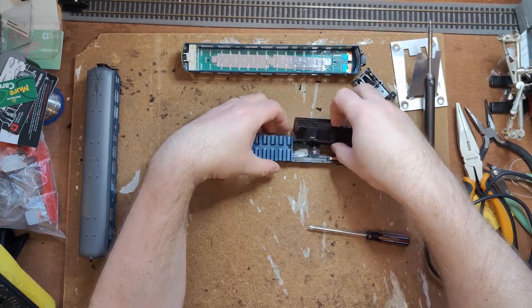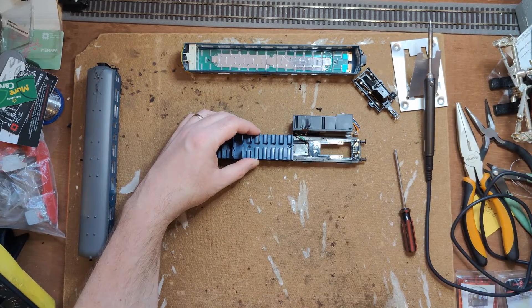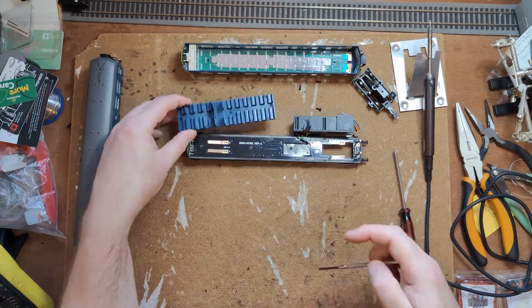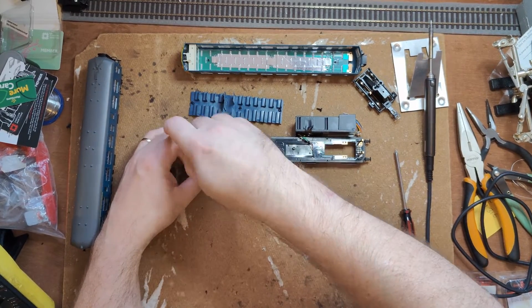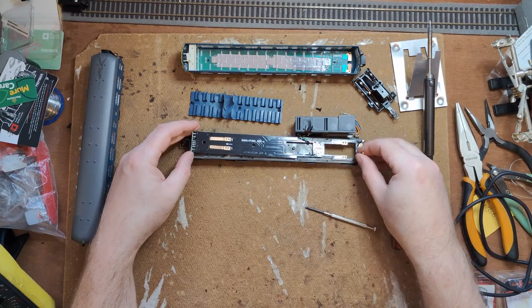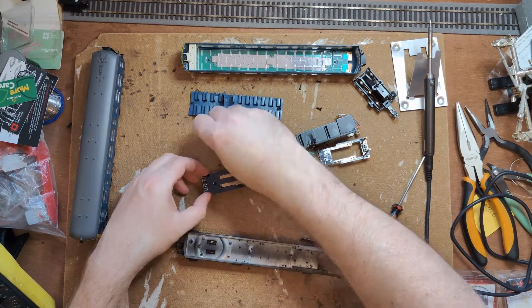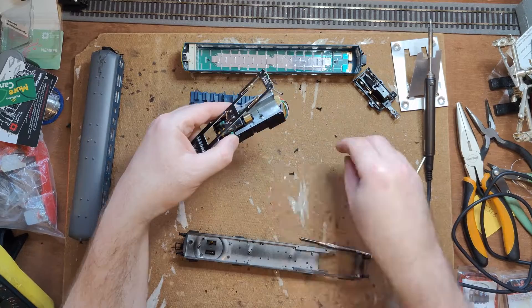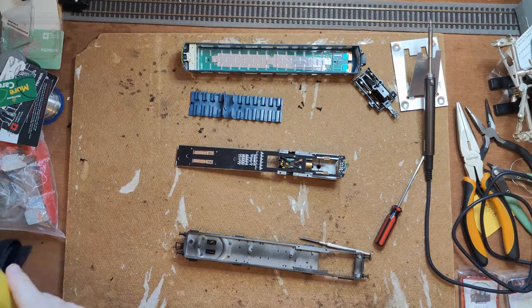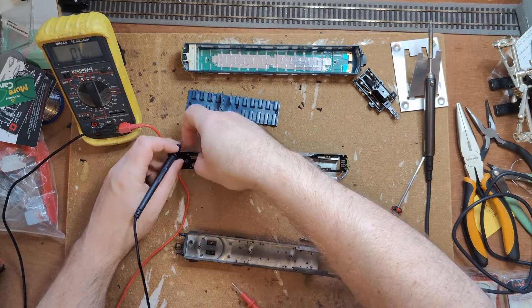And this drive shaft is tiny. There are three screws which retain the interior. Once these are removed, there are four more tiny screws to remove the PCB from the chassis. This is a black-coated PCB, so it's a bit harder than normal to trace the connections. But careful studying of the lines and some use of a multimeter to track continuity, and they can be mapped out.